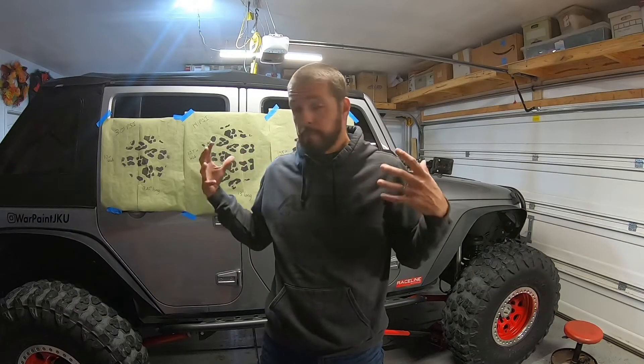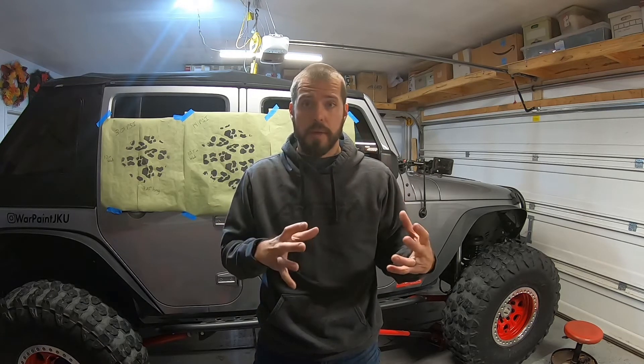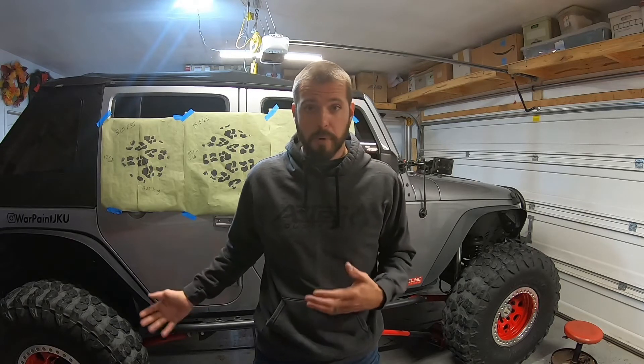As you can see, there's a big difference between the various PSIs. When you run super low air pressure, not only is it more comfortable — you don't feel every baseball-sized rock you roll over on the trail — but it also allows your tires to live a lot longer. When your tires are aired down they're more apt to mold to the landscape you're crawling over, so your tire is less likely to chunk. You will not rip chunks of rubber out of the lugs nearly as easily if they're aired down. That's a problem people complain about with the Yokohama XMT. I've been running the Yokohama XMT for a few thousand miles, rock crawling at really low PSI, and I don't have any chunking on these tires at all.